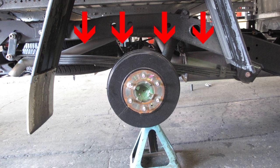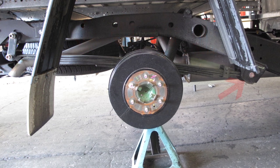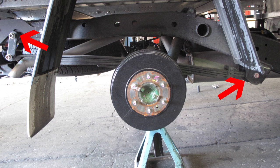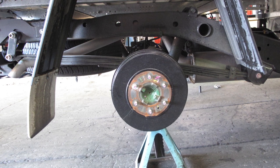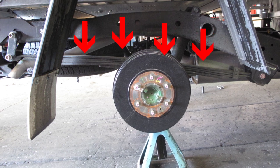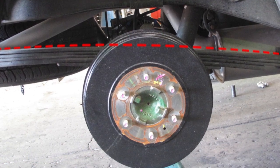Consider that the vehicle is designed to carry the rear load at two points of the chassis: at the front fixed pin mount of the spring and at the rear swinging shackle end of the spring. It therefore stands to reason that if loads are significant, consideration should be given to strengthening the leaf spring first and used in conjunction with any bellows air bag support.